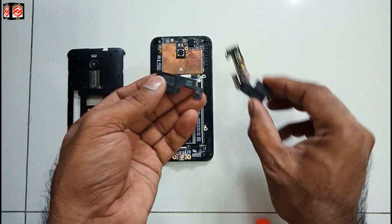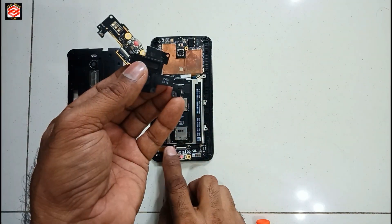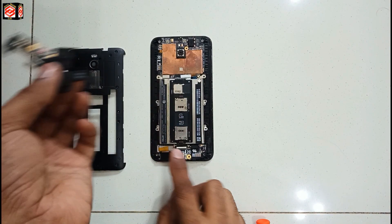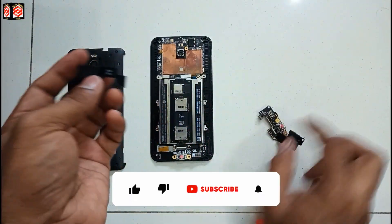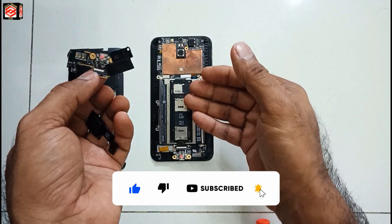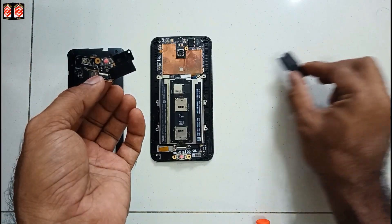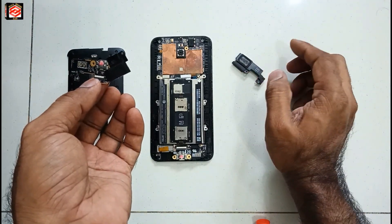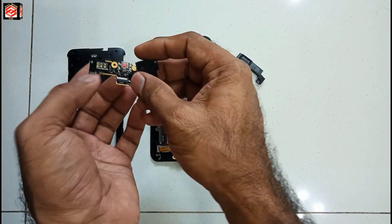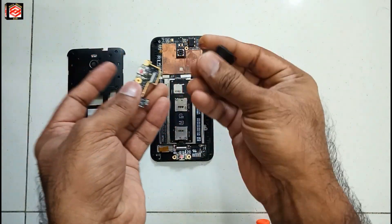This speaker is too small, but I am going to try to connect here with the two pins. You can see the two speaker pins — I just want to solder those two pins to this external speaker. I just want to get sound running on this phone. The speaker is not working and I don't want to buy a new one because it's a waste of money — this phone is only used for games for my son. So I just modify it and take out the speaker pins.